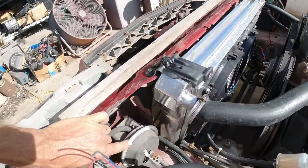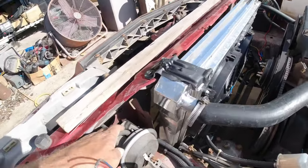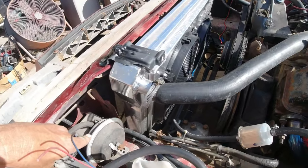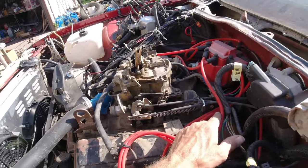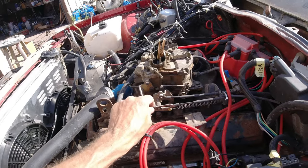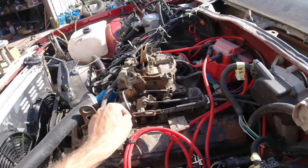The cruise control — I'd taken that off but now it's hooked up underneath. It's hooked right into the brake light and all that, so I hooked that back up. There's a tube and the wiring goes here into the firewall. I wrapped the cable and put it in a little bracket — it's supposed to be even with the gas pedal accelerator cable. I just put in one bolt there and I'll tack weld it on there if I want it on permanently.